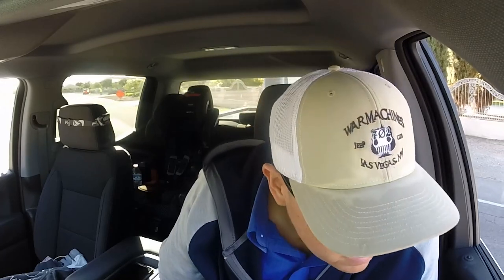Squatted the truck pretty good, but the GVW on the trailer is right at what the truck can tow. So normally I would go with a weight distribution hitch or something, but I'm just going across town, so good to go. Let's pull it on over here. Check everything out. Make sure all the lights and everything are working.